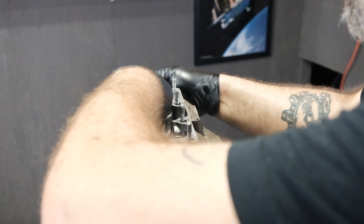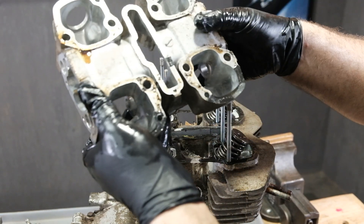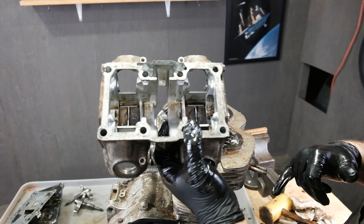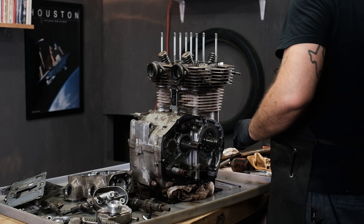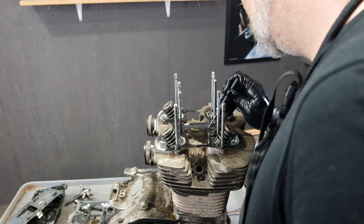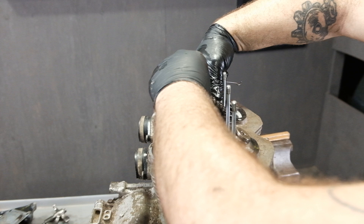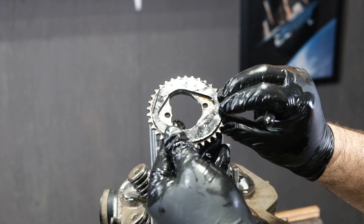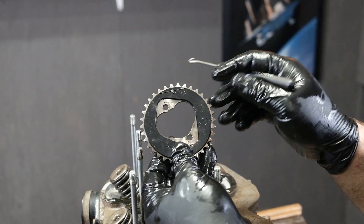Cam box here. I'm just going to let it drop. Cam box. When it comes off, there's our little weep screw. Put that aside. Let me fish that sprocket out of there. Get our sprocket. It has an orientation mark — L faces left side. That's going to be our line for top dead center. I want to put it back on the camshaft here.